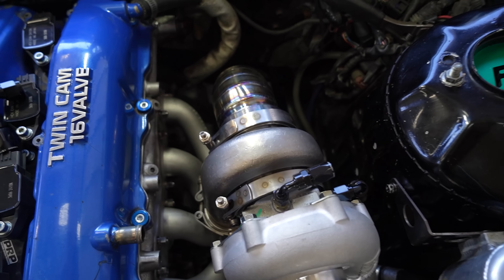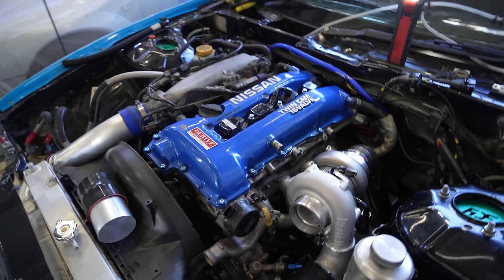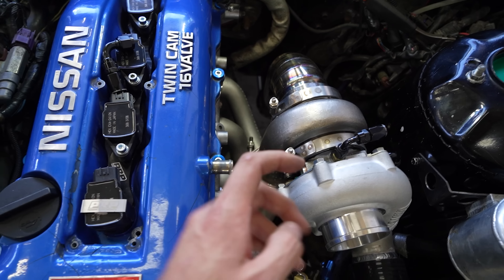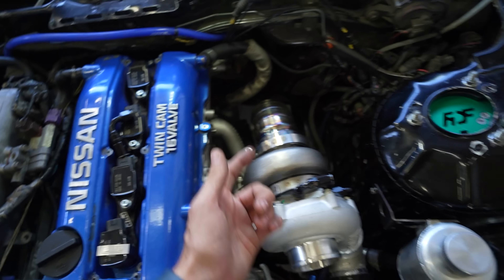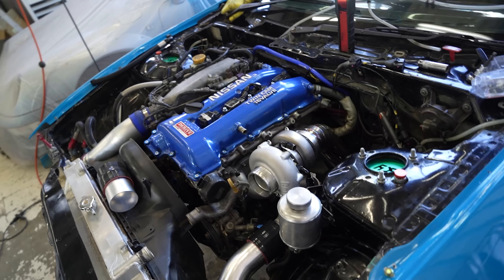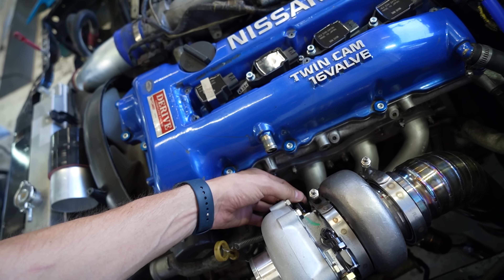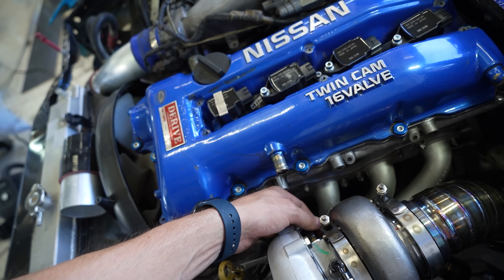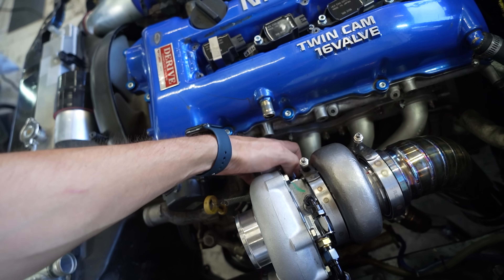I've just started on mapping out all the lines. Before I do anything, I like to put all the fittings onto everything to just try and get an idea of how it's all going to work. I found a problem where the fitting that would screw onto the turbo for the water was actually hitting on the bolt with the orientation it was clocked. Luckily with the new G-series cores, you have two ports on either side. You should try to have one low and one top, which is what we've done — I just flipped them. Now we get nice even flow through that core and we clear the bolts on both sides.